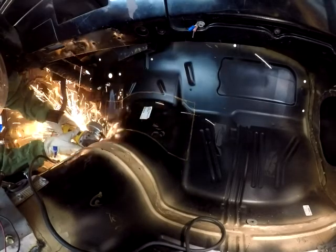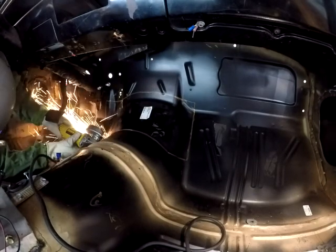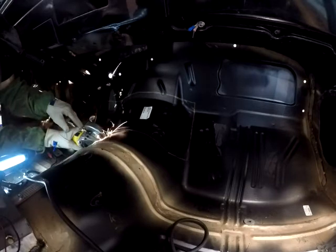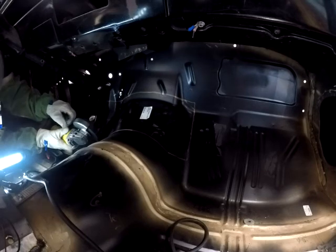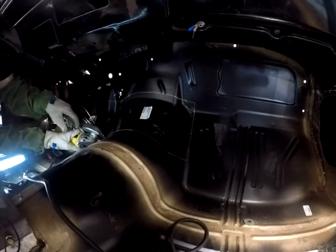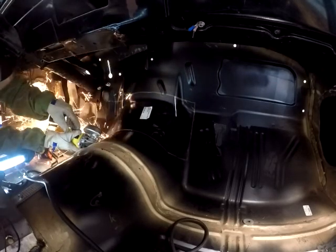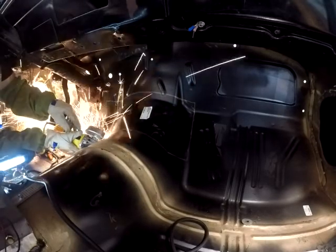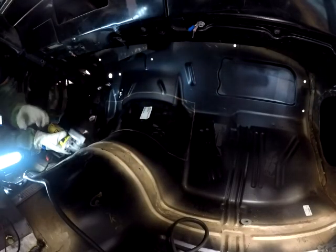You know, I bought that scatter shield a good 20 years ago and never put it in. The reason I had to get a scatter shield was because I was going to run nitrous. Well, the nitrous was all hooked up. Never ever did run it, but didn't run it because I didn't have the scatter shield in. You know, things happened after that down the line. Everything's plumbed, as you have seen in previous videos. But it was only jetted for 125, and that was because I have a stock bottom end, two bolt main 327. So here I'm currently cutting.